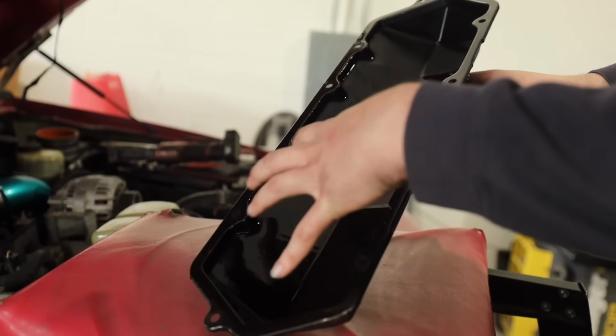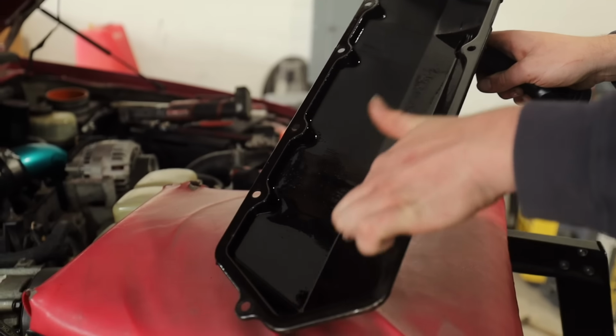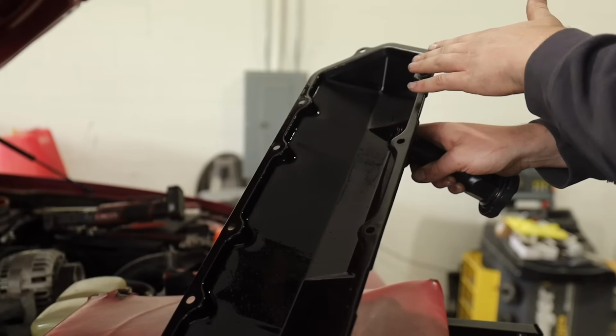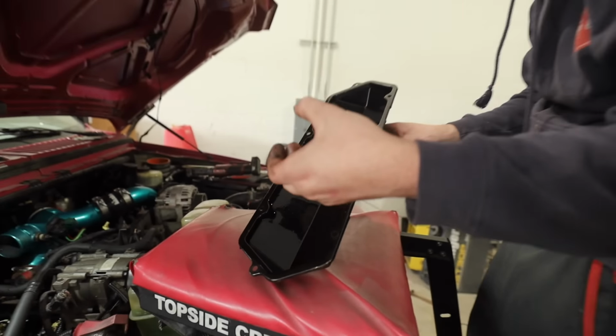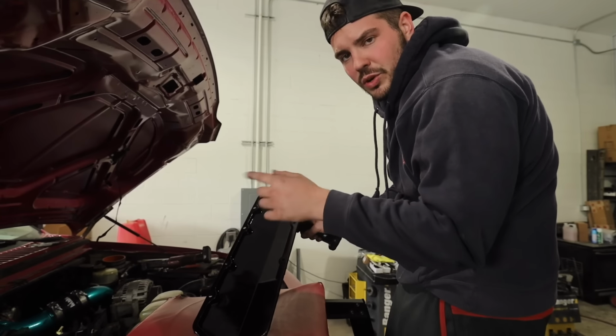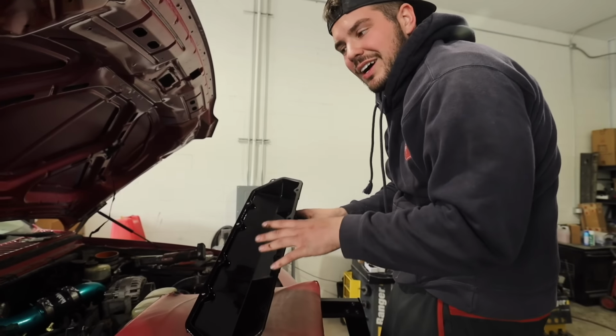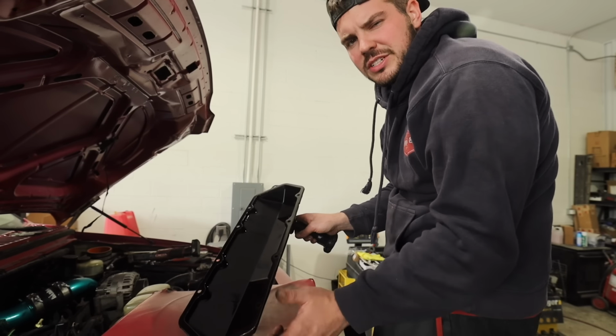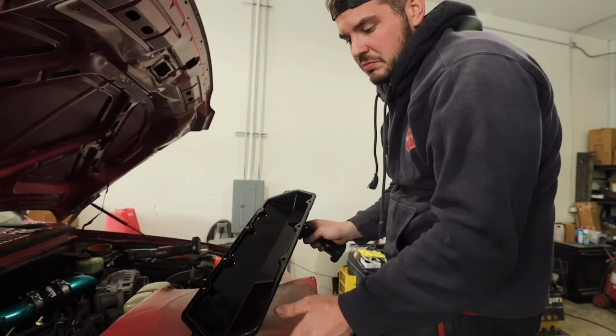Well, look at all the oil concentration that shot out. Well, that's all from number 7. Number 1 over here, barely even touched because obviously everything drains back. So pulling that rear injector first, whichever side you do it, kind of keeps all the oil out of the uppermost cylinders. So all you gotta really do is clear one. So it worked.